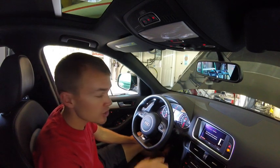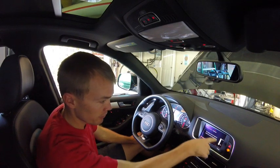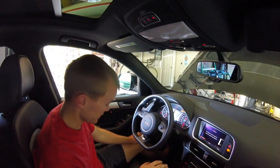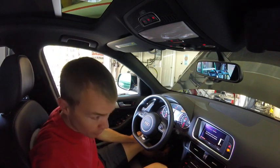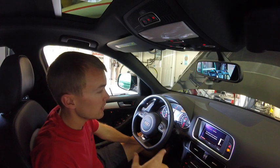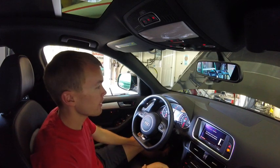We're going to go ahead, like I mentioned, and turn the car on. We're going to let it run for a few minutes and check to see where that oil level's at. We're also going to jump out of the car and make sure that we don't have any oil leak on the bottom, any oil spraying out of the hood or anything.